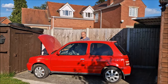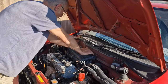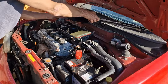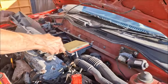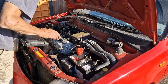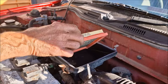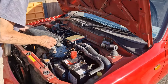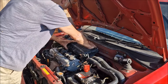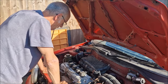Let's see if we've got any nests in here. It has had a rat's nest or mouse nest, but it was in the suspension top and in the air filter. She's not running right, is the honest answer — she keeps dying. Could be that horrible fuel — we're expecting it is. We've got no nests in there, so let's not panic about that. Taking time to wake up is what we're thinking. Hopefully we don't need a whole new throttle body and MAF sensor.